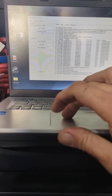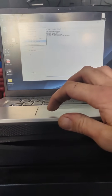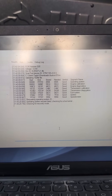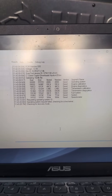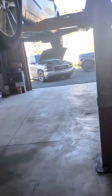Back to PCM Hammer. I'm going to reinitialize my device, make sure it's communicating properly — and it is. Hook back up. All I've got to do is come up here to Tools, go down to Write Full Flash, parentheses Clone. A clone will clone it to be indistinguishable. In four minutes I will have a fresh flash. Operating system request failed — checking for a live kernel — checking for recovery mode — unlock not required — unlock successful. Now it's just going to go ahead and overwrite the whole thing. It just isn't a problem.